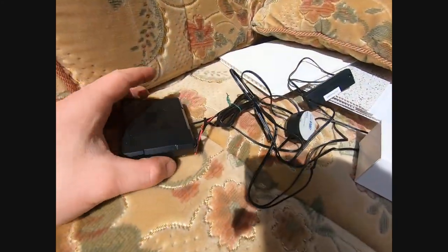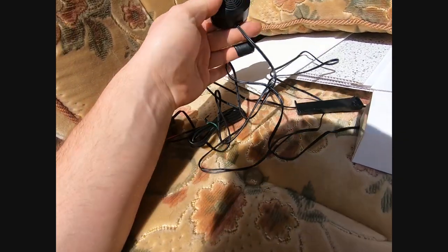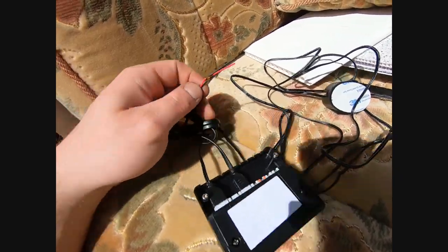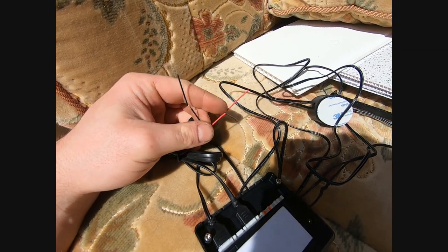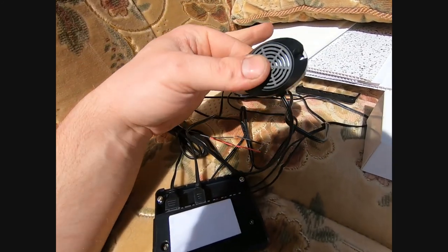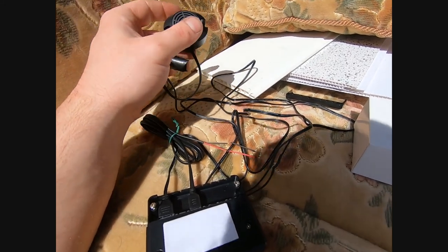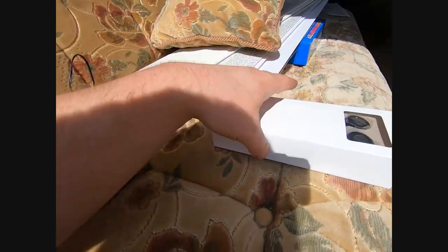I'm going to open the back doors and show you what we've got. This is a very simple set — four sensors and just a buzzer, so very simple to wire up. We've got positive and negative: the positive will be wired into the reverse light, so when the reverse light comes on it powers up the module. The black one's just a ground, and this is the reversing beeper, which I'm hoping is loud. It'll probably be hidden behind one of the seats.